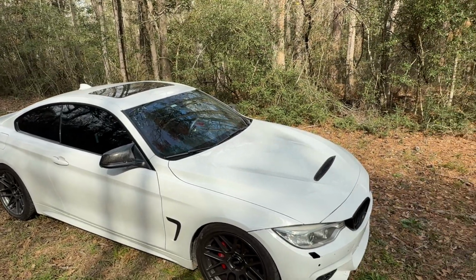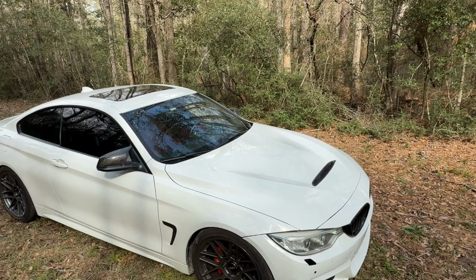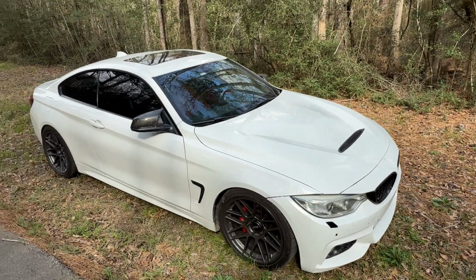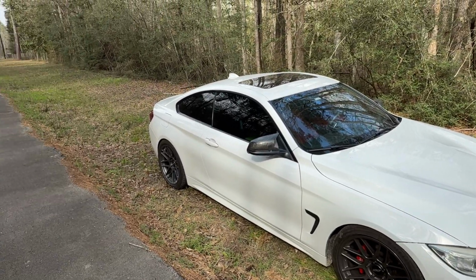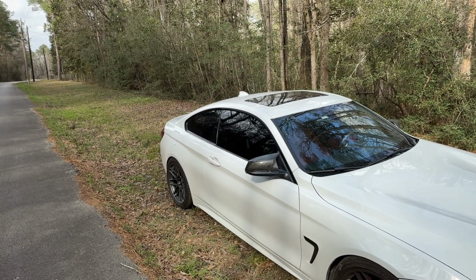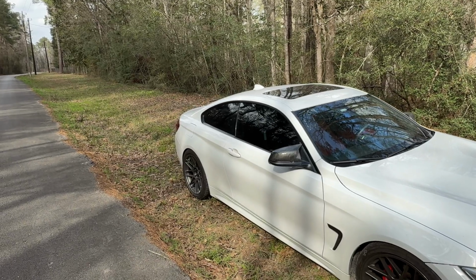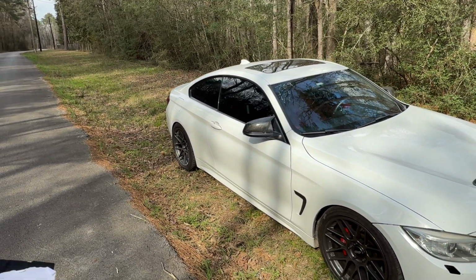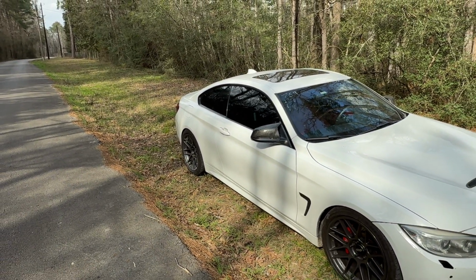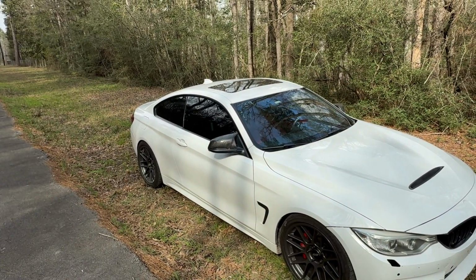Okay, now miscellaneous things. A GTS replica aluminum hood. I believe that drops like 20-25 pounds. I do remove all passenger seats, meaning the front passenger in the front and the rear bench with the seat back and the side cushions. That's basically to decrease the weight, so for weight reduction. And I do run a lithium battery.